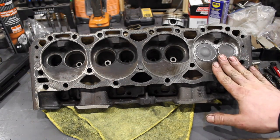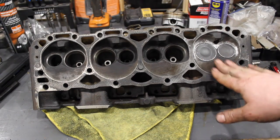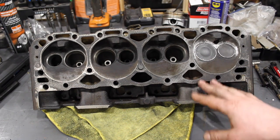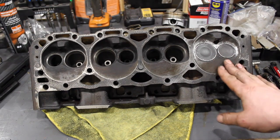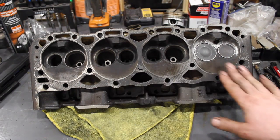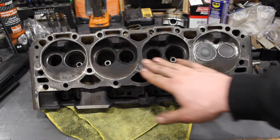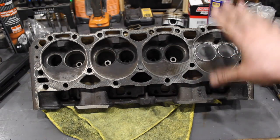So it's going to go from stock to more of a full port. I'm not going to go ham on the intake inlet — I'll do a little bit of casting cleanup — but then we can see what makes the biggest difference. Is it going to be the pocket porting or is it going to be the combustion chamber? It's going to be really interesting.